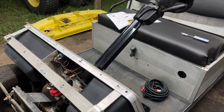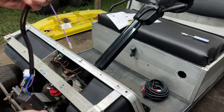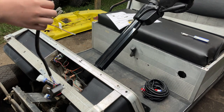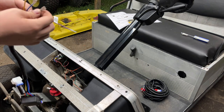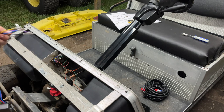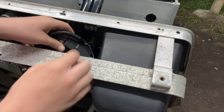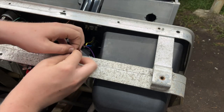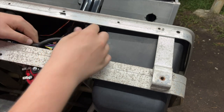Now I can connect this box with the relay and all the connectors. I've got the connector right down here from where I pulled it through the dash. We also connect these three wires on this little harness to the back of the hazard light switch — yellow, blue, and black — in that order, with black on the bottom right across from the little LED on the switch: yellow on top, then blue, then black. I'll zip tie this little box to the frame.